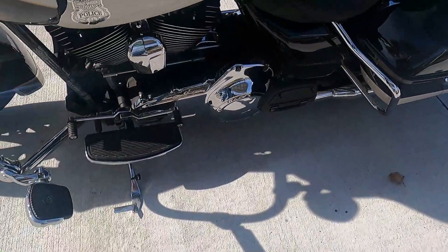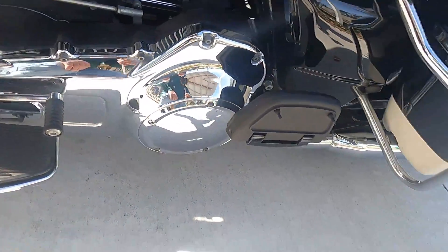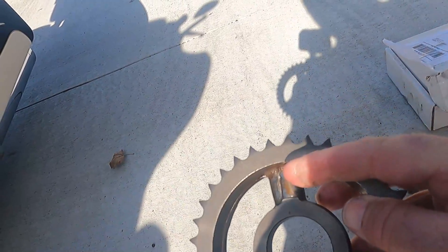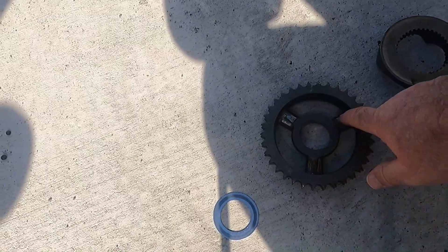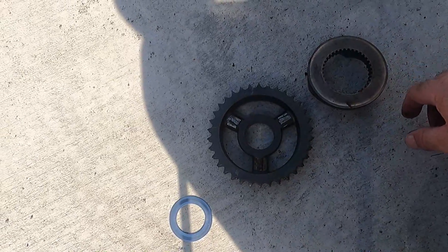One more thing I've done is changed out the compensator. It was making a lot of racket. The compensator is back down here, hooked to the crankshaft on the engine. This is the old compensator — if you look at those points right there, you can see they're ground down pretty good. What was happening was these spots sit down in grooves and rotate to take up the torque, and as they were going through those grooves and cutouts, it was making a god-awful sound — it was really bad.